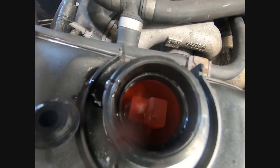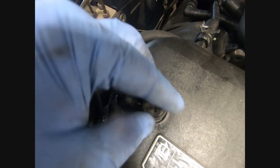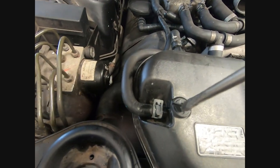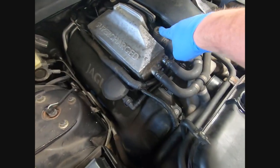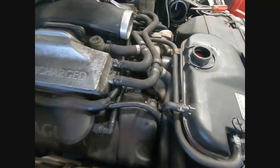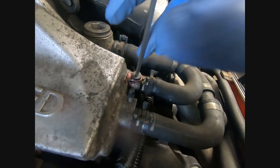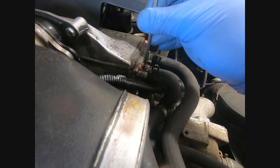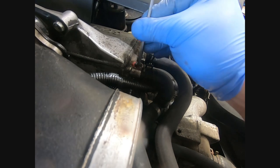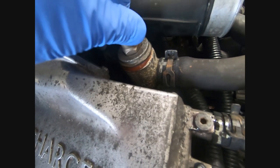We're pretty much just up to the maximum level - maximum this side, minimum this side, all full up. There's an electric water pump down the front. With the ignition on, I can crack off the bleed screws and have coolant come out. You can hear the buzzing down there - a lot of air going through. Cracking off the screws: we've got flow out of that one already, and coolant coming out of the second one. There's the air coming out - there we go.